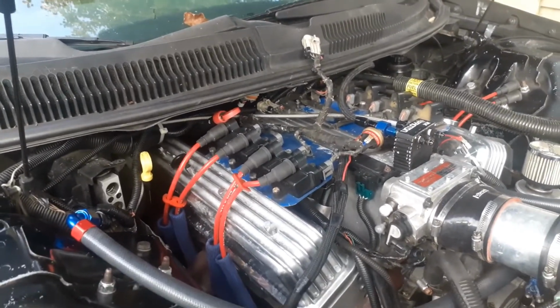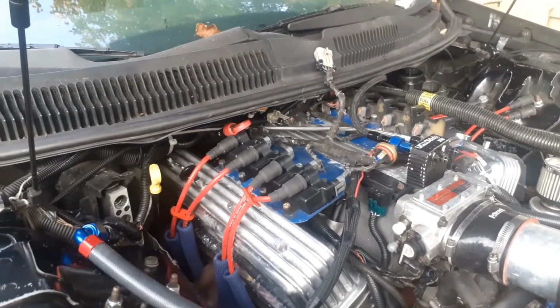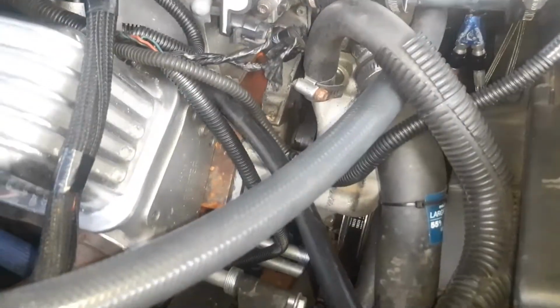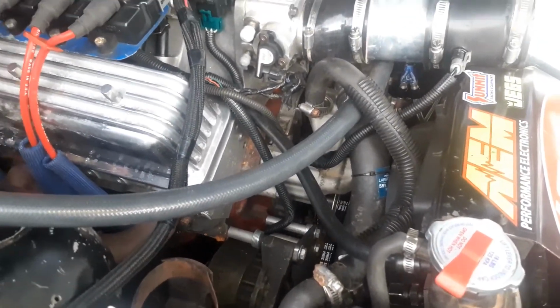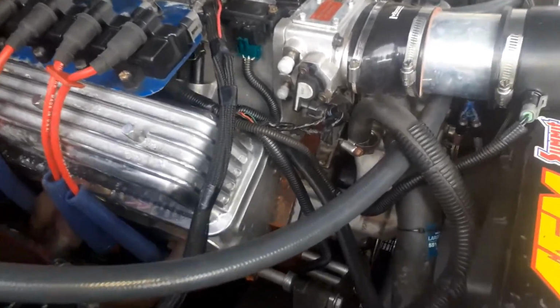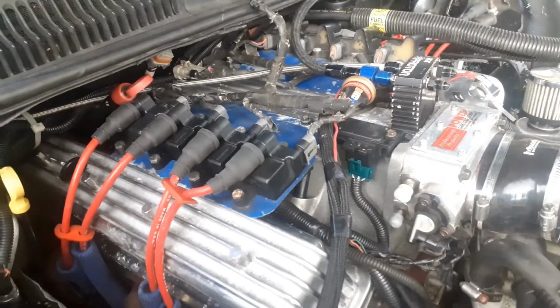And when it is under 1.19% throttle or something like that, it goes to the idle table. But I'm gonna see if I think that crank sensor is bad. And I just replaced that crank sensor. That crank sensor is actually what caused the nitrous backfire, or caused me to blow a head gasket under nitrous before. I'm telling you, I'm getting sick of this fuel injection stuff.